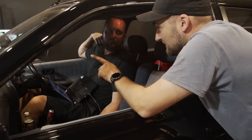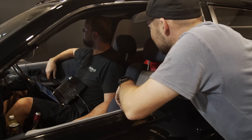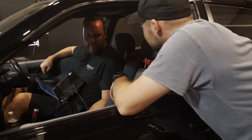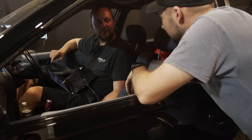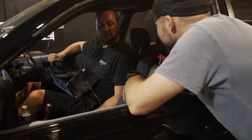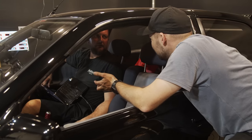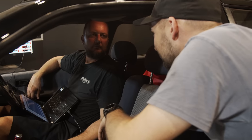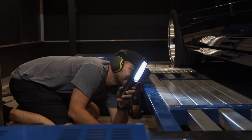What's more worrying is that it looks like one of the calipers — front or back, potentially both — is dragging. We can't have the brakes dragging the whole time. That might send us home on a tilt tray. The pedal feels really hard to explain — the booster works, but it almost feels like it doesn't have a booster. It's got about an inch of travel and then you're stuck there. It feels like a caliper's sticky, possibly rotors and pads from sitting so long. We checked the pistons and they looked all right, but brakes don't seem to be actively dragging, so we decide to monitor them and press on.